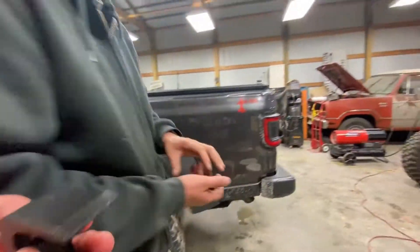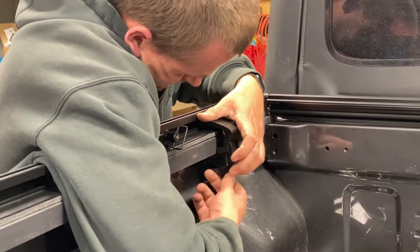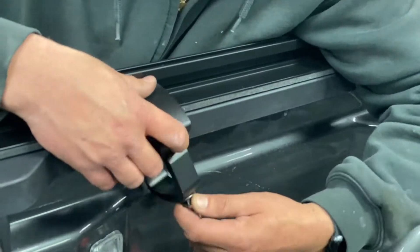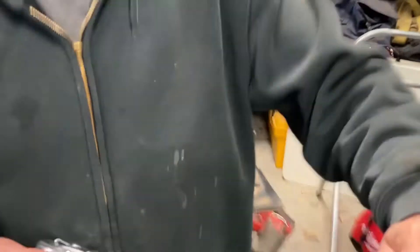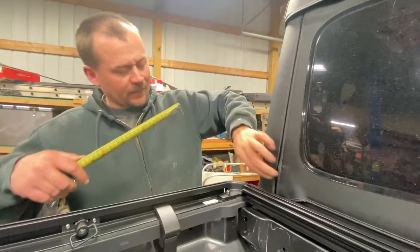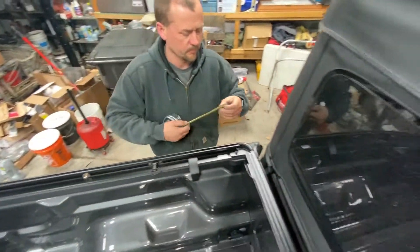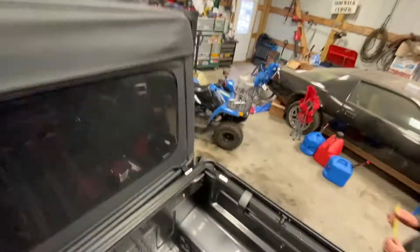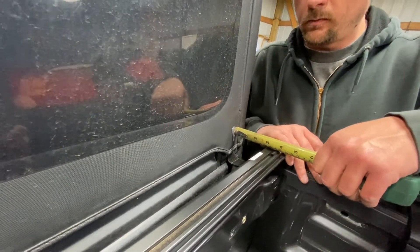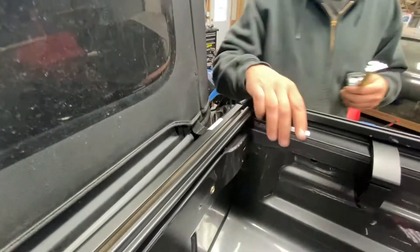On the bottom of the clamp, if you don't have the bed rail system. You want me to measure two and a quarter inches back. Just from the back, yeah. Almost exactly. And this is so when this is laid back there's enough clearance from the back window of the top and the soft topper, right. And it's also just going to help get it square.